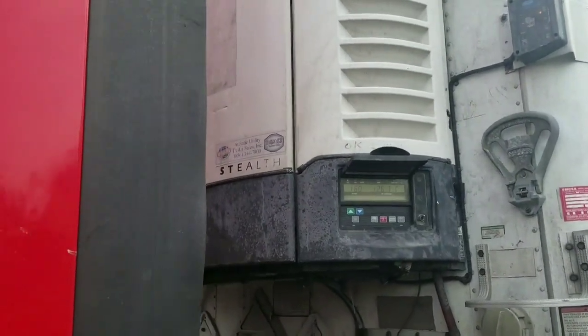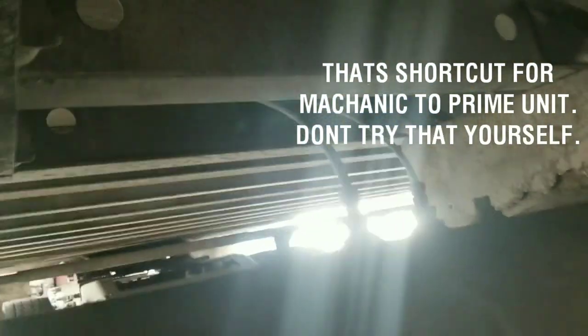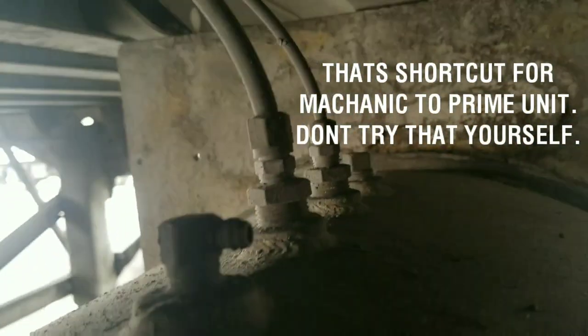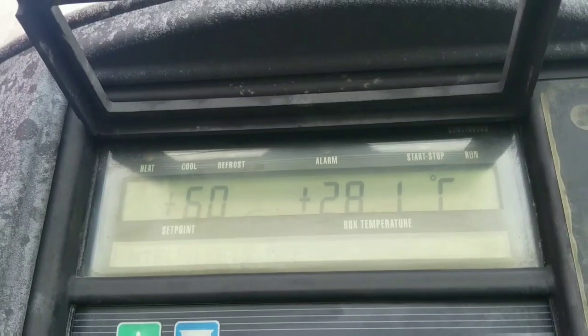So you can also put some air into the tanks, which I'm going to show you right now. You see this fuel tank right here? You just take an air hose and put it in there — make sure you give just a little bit, not too much, because you could blow the tank. Since the tank is full, just give a little bit of pressure, and that pressure is going to help the fuel go into the fuel lines and prime it quicker. We're all set.